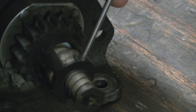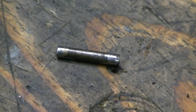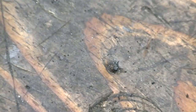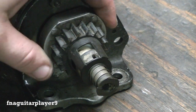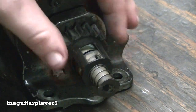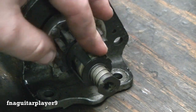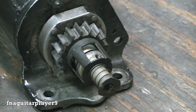Keep an eye on it — there it is. This is the pin here after you get it out. It's pretty small, so don't lose it because it's very important — without this you can't use the starter. To make things easier, if the starter has been sitting for a long time, put some WD-40, PB Blaster, or some type of penetrating oil in there, let it set for a while and that'll make it easier to knock out.